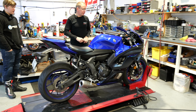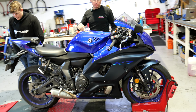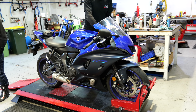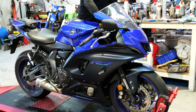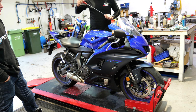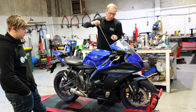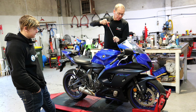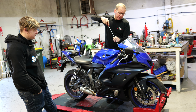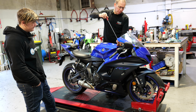Now we're going to do the same to the fork. And same, I want it to go down, come back, and then rest. Yep. I don't want it to wobble. So, and you can see, it's better now we've actually stiffened that spring up, but still you've got that goes back down again. Yeah, it's got a bit of a wobble to it. So I'm just going to count how many turns we're out. And same, all the way in is our stop. Okay, that's the problem. We're all 1 out. It's as slow as it will go. Yeah. Just going to see what your total is.